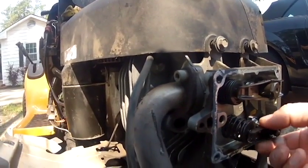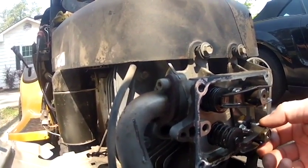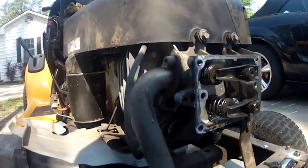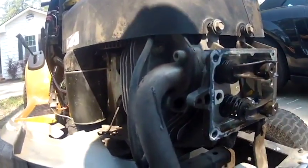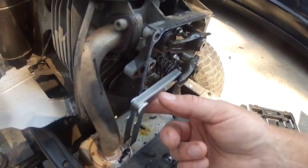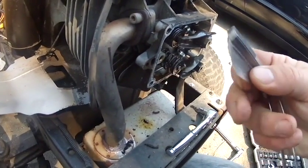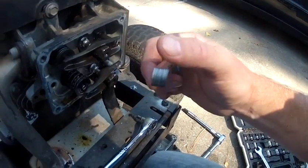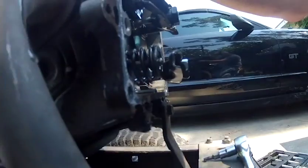See when you get to that point where it's just there — that's considered top dead center. Now see how there's all this play? There should not be nearly that amount of play in this motor. I actually had to go in and check the clearances on this thing — I'm simply amazed. The entire feeler gauge pack fits in this gap. Is there any wonder why this motor won't start? It should only have a very small gap at this point.